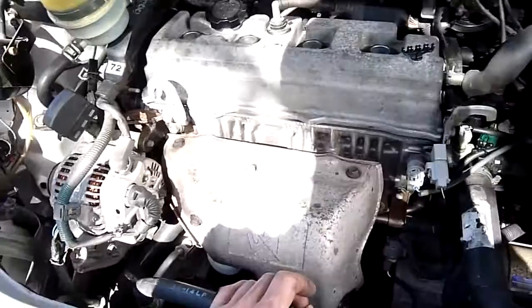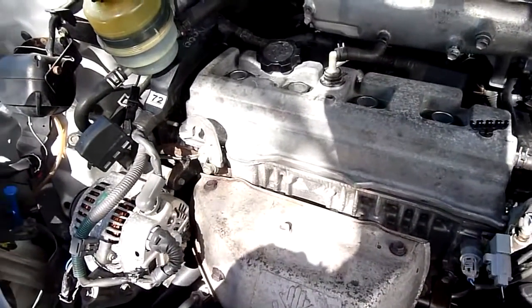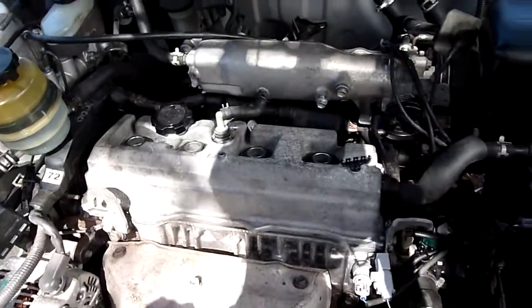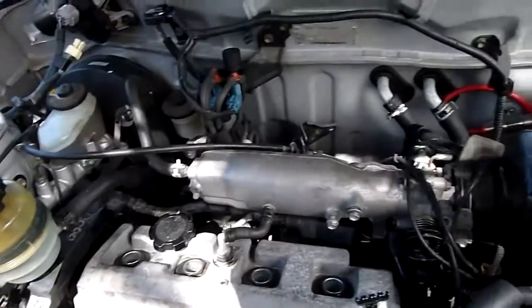I don't hear bottom end noise. I don't hear anything that sounds particularly like wrist pin noise or gudgeon pin noise. So, just see how it goes. She might last another 200,000 Ks or might only last 50,000. Doesn't really matter. Cheap cars are cheap cars. You can't complain about getting something that's not brand new.